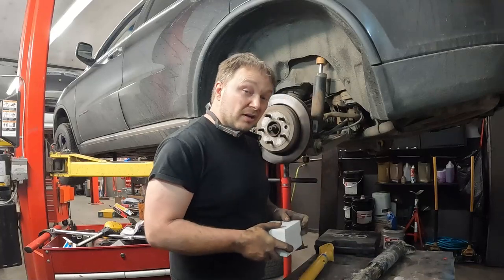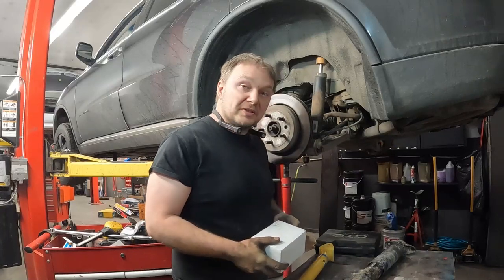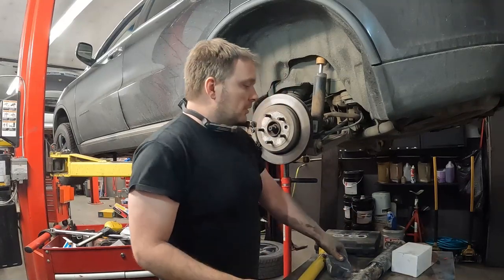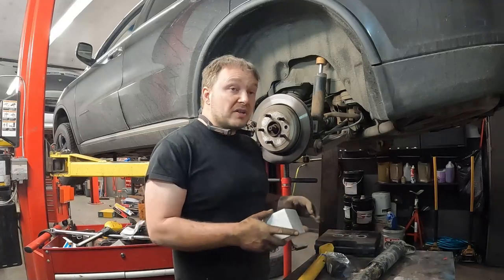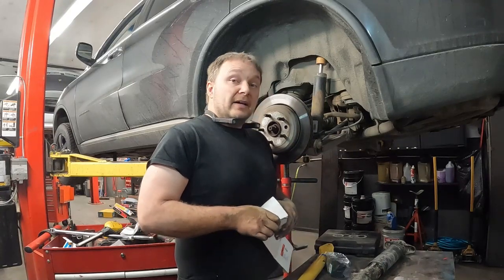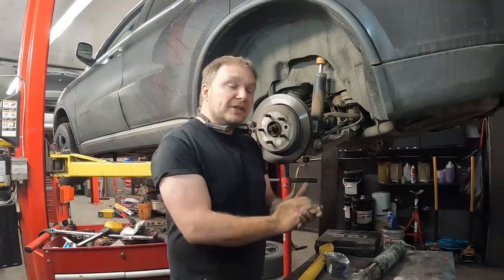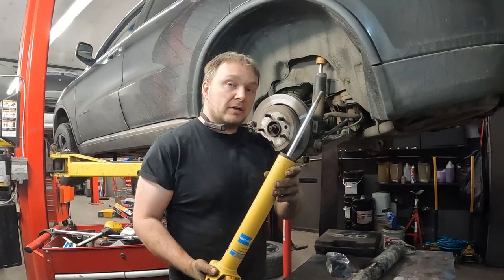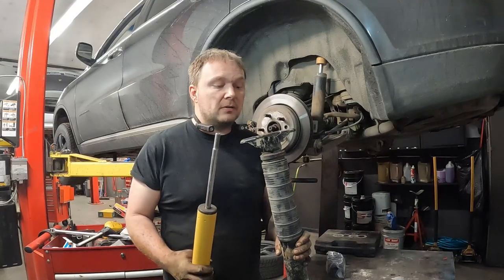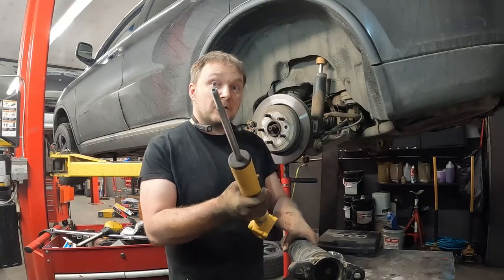You need the shock mount. Kind of learned that the hard way. Learned a lot of this the hard way last week and went to go put this in. And that's when I found out, yes, in fact, I did have the load leveling shock. So then there's the question, can I install the regular one? Because I don't want to put something that expensive in. And with doing a bit of research, yes, I was able to find out that you can put the standard shock in. You don't have to put one of these in. However, the thread size is different for your rod.